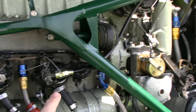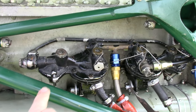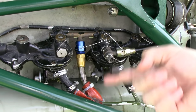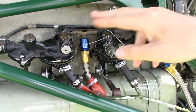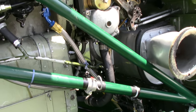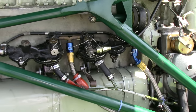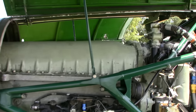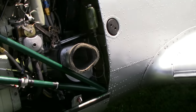Right. Is this the fuel system coming here and regulators? And it's the two fuel pumps. Yeah. Mechanical wobble pumps. We prime it here. We're on the ground, we'll be priming it here later. And these two just run off the cam, suck the fuel up, and into the carb. Wow. The carb sits on the other side. And we've got not a dissimilar frame really to how we had on some of the Warbirds. It just comes off and supports the engine. Very, very similar.